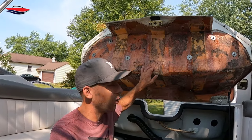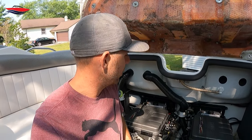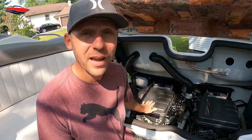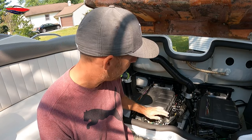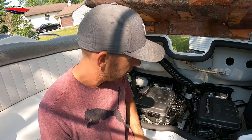The reason I'm cleaning mine today is because I finally pulled all the mat and stuff off my engine hatch. I've already cleaned it but I'm going to show you again how I do it. Remember, these are jet ski engines — they're designed to get wet. You're not going to hurt anything. Just like degreasing any engine, it's fine. You just have to watch out for a couple of certain spots, mainly your electronics, and we're going to go through that right now.